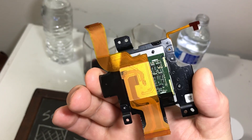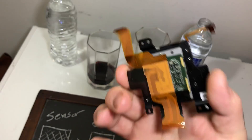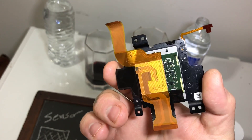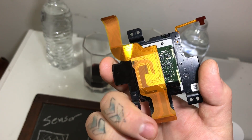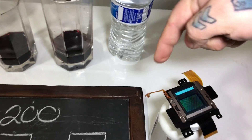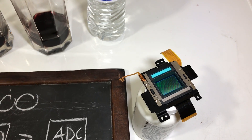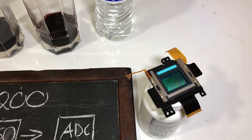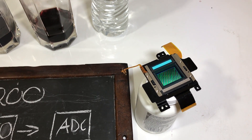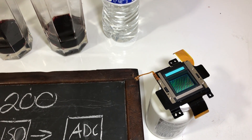Nowhere here or here is there any ISO. Now, you see these two flexi cables that are gold-colored here? This is the signal feed which goes to the controller board. And you see this other little cable right here? Yeah, that goes to a piece of cover glass which sits over top of the sensor, which has a little strip that ultrasonically vibrates the cover glass. This is what sensor cleaning is, by the way.